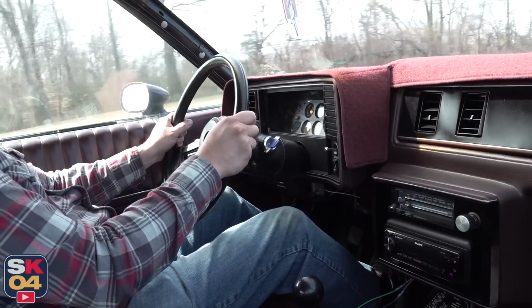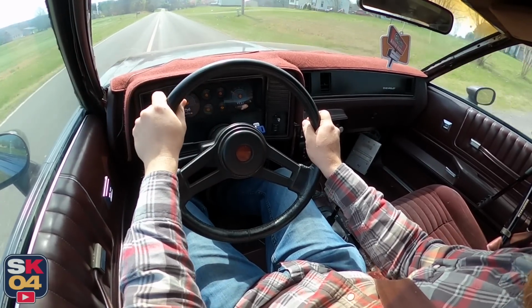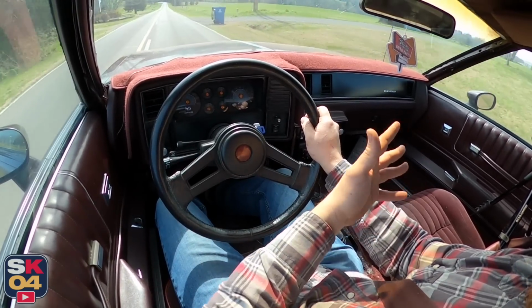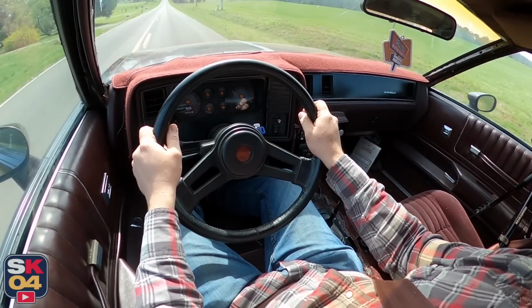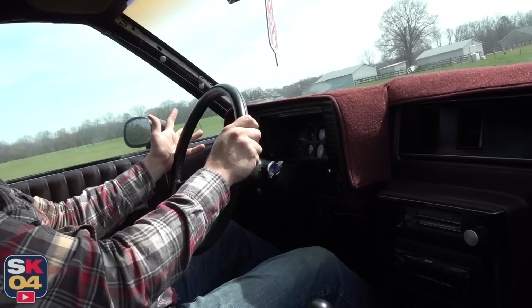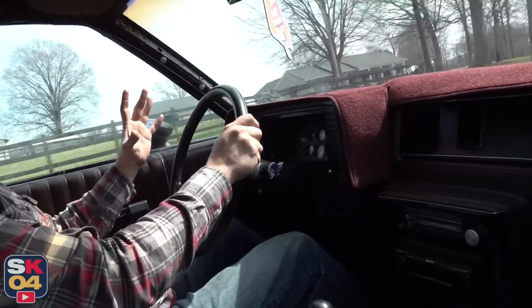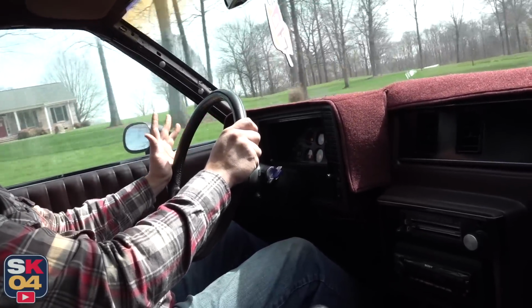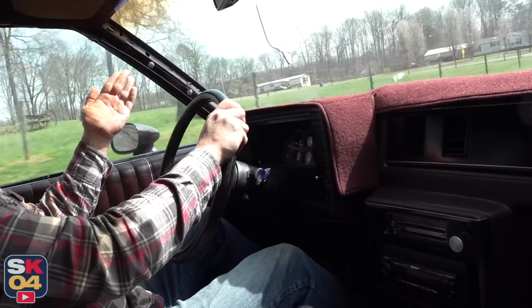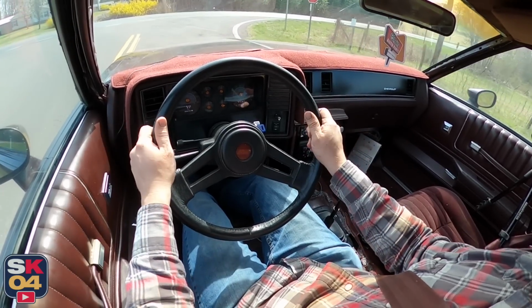Transmission is awesome. So there were a few little headaches that I had to kind of figure out. They had nothing to do with the swap kit, just physical clearance issues and stuff like that. Because I used a World Class T5 out of a 3rd gen Camaro, it has that external slave cylinder on the side, and the housing that the slave cylinder bolts onto actually hit my long tube headers. So fortunately, I was able to just lop a little bit of that housing off to make enough clearance, so no issue there.